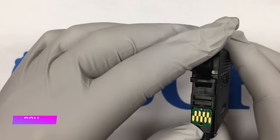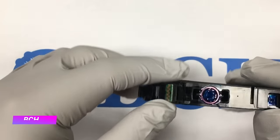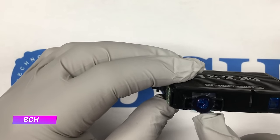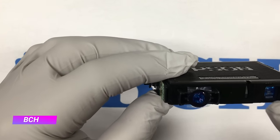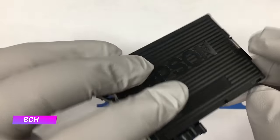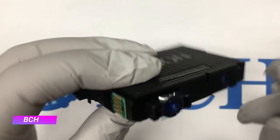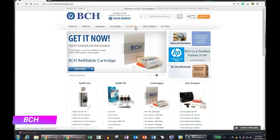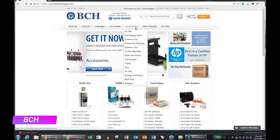The second homework is how to unclog the printer. We may be using a new ink or even switching from a pigment to dye ink. Furthermore, the refill activity may introduce air bubbles which block the printhead. Knowing how to unclog is very useful. There are many videos on how to unclog the printhead, and we may add some more later. By the way, we have a special adapter to remove air bubbles out of the cartridge.